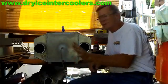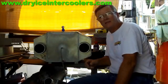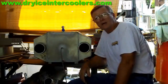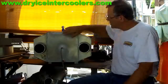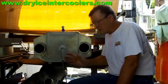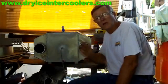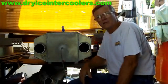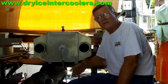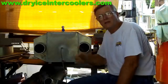The nitrous has expended. You might have to convince your tech official that this nitrous oxide is not entering the intake charge — it's only cooling this box down for your air to come back into your throttle body or carburetor. This box is frozen and has done its job. Go back to the pit, get the car ready for the next round, switch or refill your nitrous bottle, and you're ready to go again. It's much more efficient than dry ice, which is hard to store and hard to come by. Nitrous oxide is very available, and if you have a source, it won't be very expensive to use this type of system.